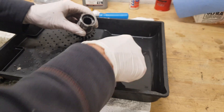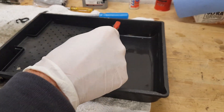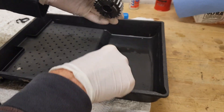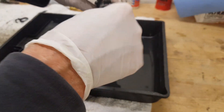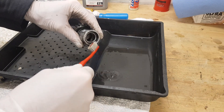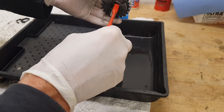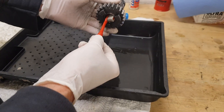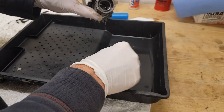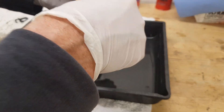I'm going to finally remove that oil seal. I've got some white spirit and I'm going to clean out what remains of that oil seal, but also some of the dirty oil from inside this high gear — because I know from taking the gearbox apart how gungy the oil was. However, you've got to be really careful you don't damage these needle roller bearings in doing so. By that I mean: you don't want to turn the bearings around once they've been cleaned with white spirit, because as soon as they're clean and free of oil you're damaging them. Any bearing — you turn it over dry, white spirit clean it, then just by running it round a couple of times you can ruin the bearing.